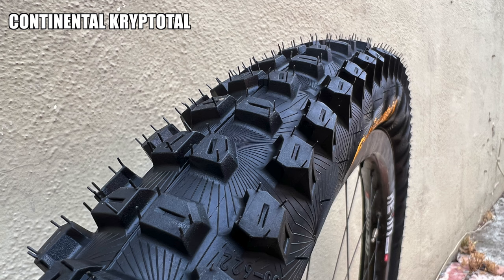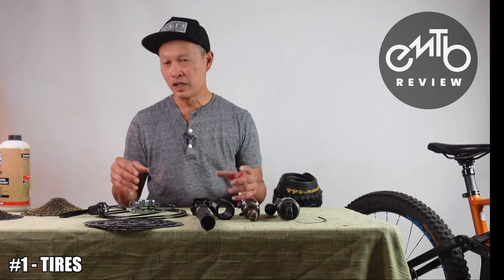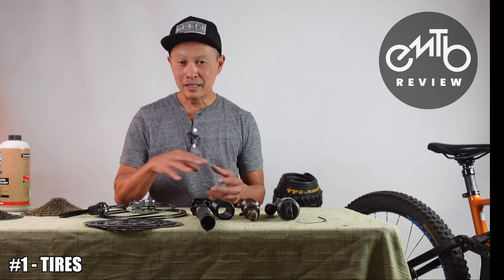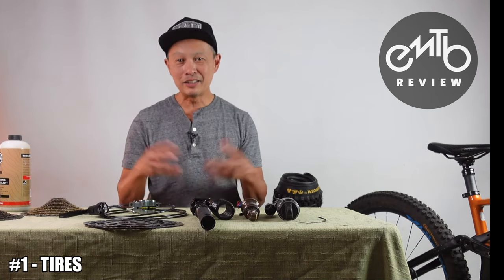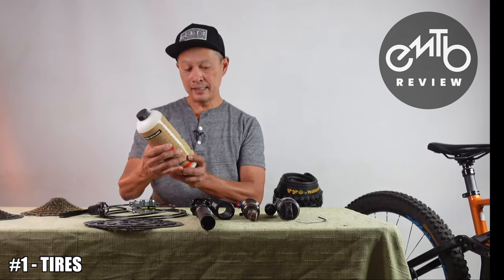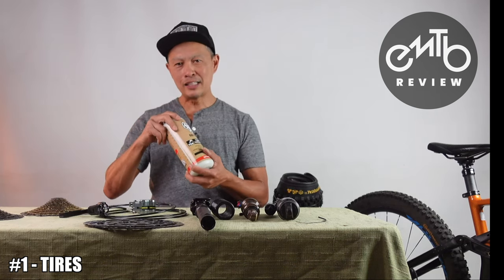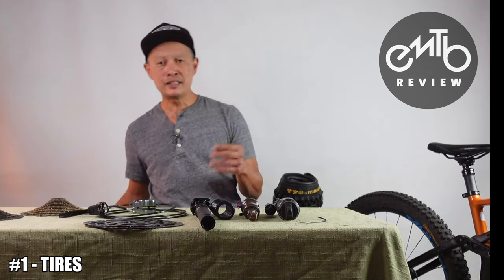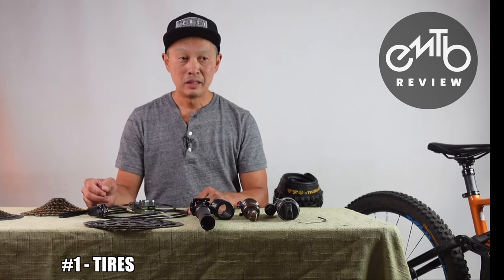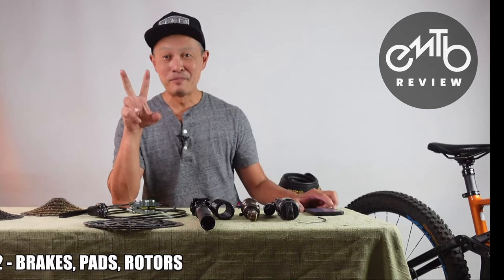Still on number one — upgrade to tubeless if it's not already. Usually bikes don't come tubeless from the shop because the tire loses air on the floor; they need to be ridden to really seal. Really manage your tubeless sealant — it's a big problem in the industry. You need a couple of ounces in there floating, but it always evaporates after about six months. A good sealant is this new WTB one — lots of sediment and it doesn't evaporate as quickly. My last four flats in my group were all tubeless tires with no sealant left — nobody tells you to refill it in the manual.